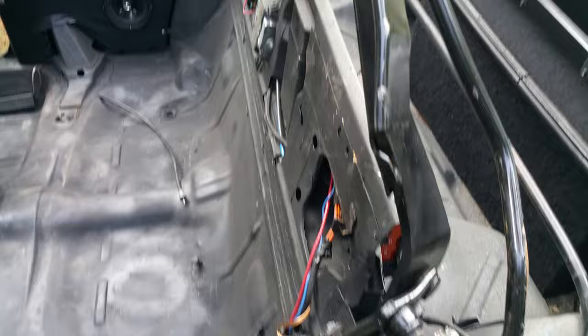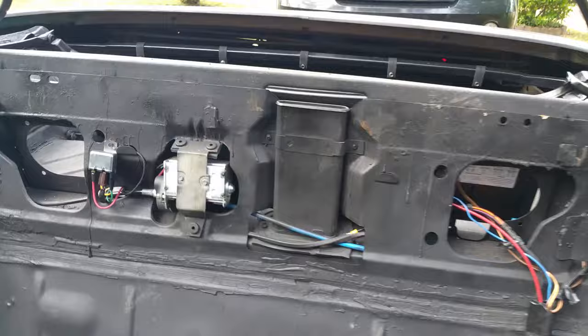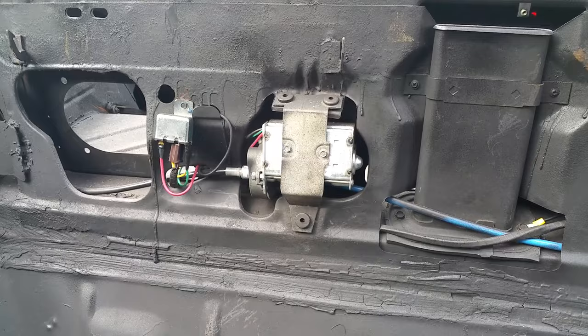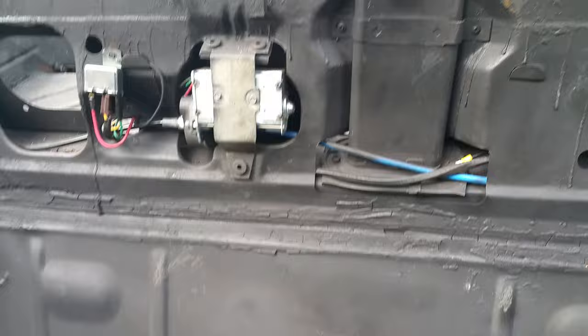That's basically how it works and I hope it helps out somebody who really wants to work on the car and get it straightened out. Check your cables, check your actuator. Sometimes it's better just to get a new motor — when I took this one apart it was full of rust. It was working halfway but it was full of rust. The bushing was burnt up and all kinds of things. So if you're going to keep the car for a while and do something with it, just get a new motor and that way you ain't got to worry about it. One day you catch it in the rain and it won't go back up.